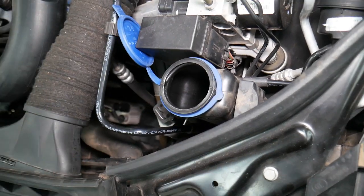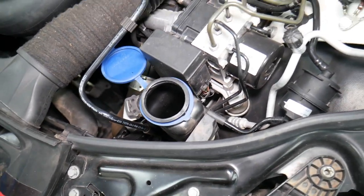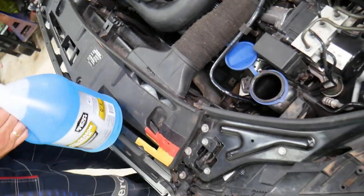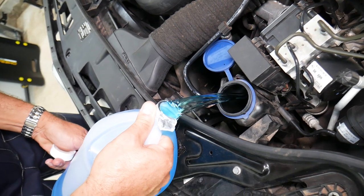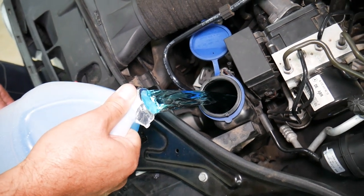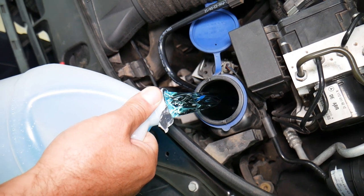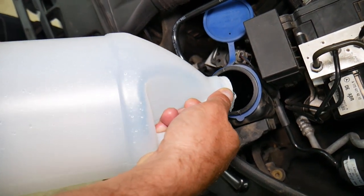If your warning still stays on after filling, we'll explain what else could be causing that. We recommend using only Mercedes-Benz approved formula, because otherwise it can mess with the pump, hoses, and things like that. We're opening ours now and going to start adding it. Even if you spill some, it's fine, but if it's in the garage, clean it up — kids and pets should not taste that or get it on their skin. It takes quite a bit; this is a big reservoir on most Mercedes vehicles — over a gallon in some cases.